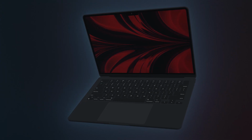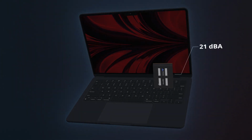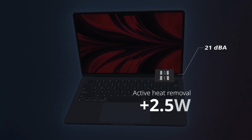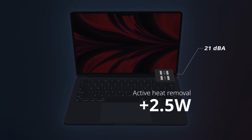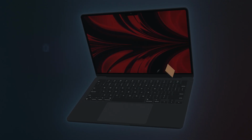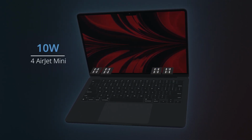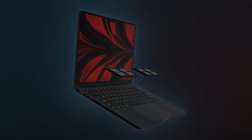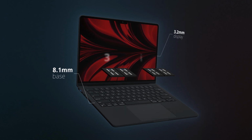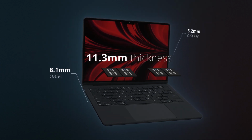silent. Each AirJet Mini runs at a silent 21 dBA, and through active heat removal adds 2.5 watts to the notebook's sustained processor power when implemented in an 8.1 mm base thickness notebook. 4 AirJet Minis equals 10 watts of active heat removal, and an 8.1 mm base plus a 3.2 mm display adds up to an 11.3 mm notebook thickness.